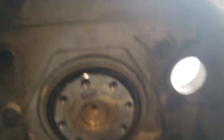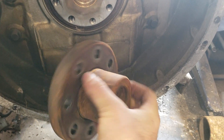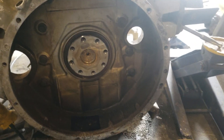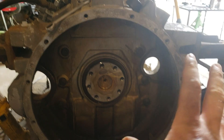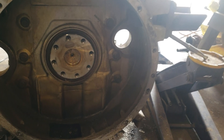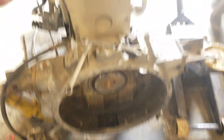There we go. I really thought that was shooting down my whole project — that I was going to have to change the crank or get a whole different motor. I was really sweating bullets for a minute until I hit it with a hammer. I just wanted to show that with you guys, so if you do come across an engine for your swap that came out of a truck with a heavy-duty Allison in it, don't be scared. Don't look at that and say that's not going to work with my transmission because I'm using a standard — it will. Normal Cummins crankshaft right there.